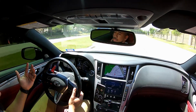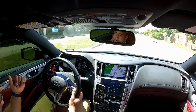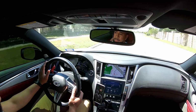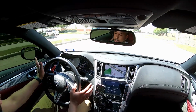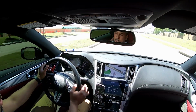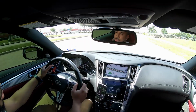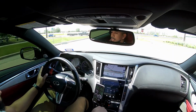They cleaned up the boost control, from the email that I got. They also cleaned up the launch control. It's supposed to spin less, and also supposed to be able to hold it longer than before, until you let go, technically. So we'll test that out as well. And also there was some knock in fourth gear that I was showing, which, you know, it's always good to get your tune checked out. That's why we send data logs in.